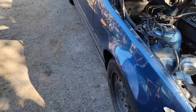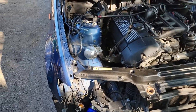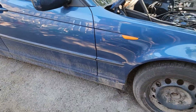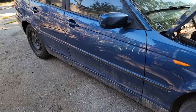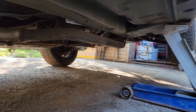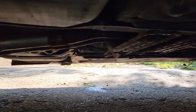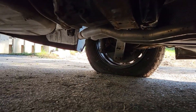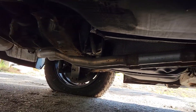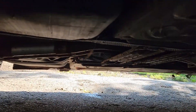I'm gonna take these pipes out and do a little cutting and welding. I'm gonna jack this thing up and take the old exhaust off — the mid pipe underneath only goes from the flange back to where the muffler used to be, and we need a muffler on this. Car is jacked up right now — you can see the pipe goes from the front to these brackets and then out there, and the muffler is cut off. I could just weld the muffler to that, but I have a full exhaust behind the shed.